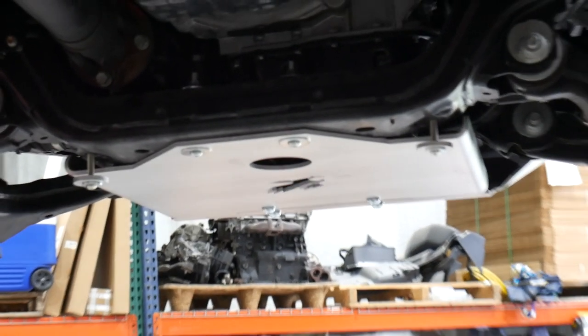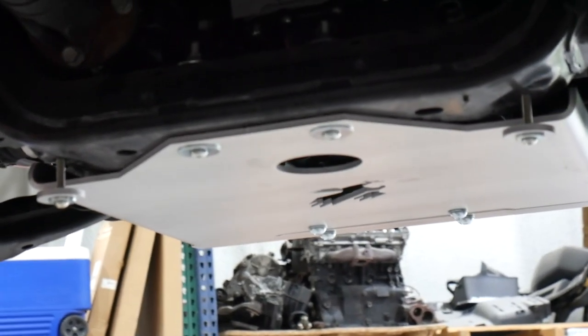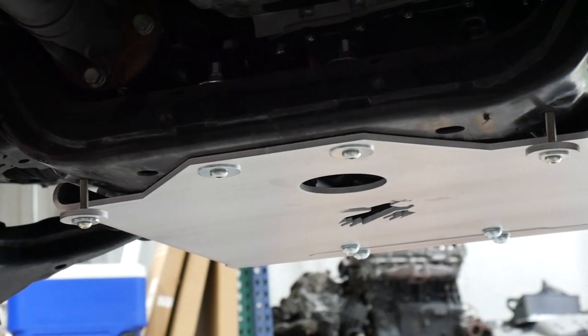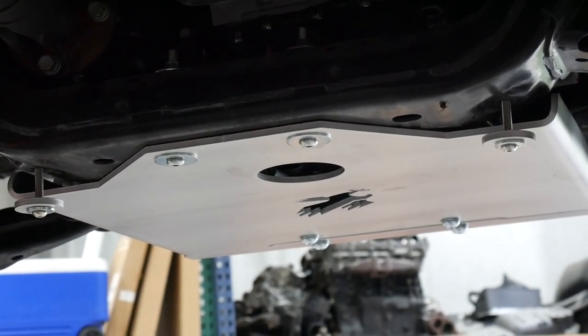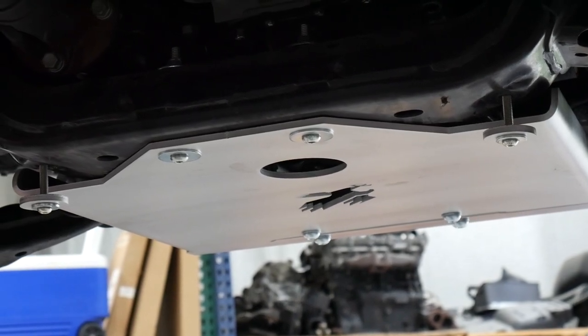In this video, the CAT Shield is being installed with our engine skid plate. If you have a factory skid in place, you will remove the two rear bolts to allow the plate to hang down. Reinstall two of the M8 x 40mm bolts supplied, along with the two larger washers and two aluminum spacers. Leave these bolts loose.